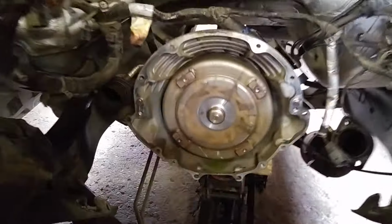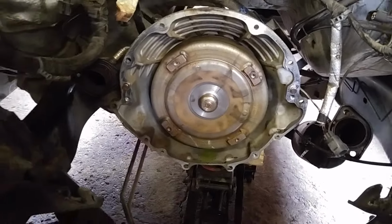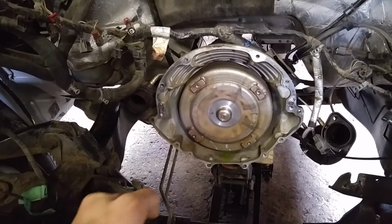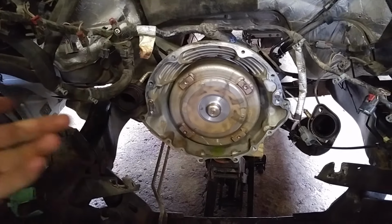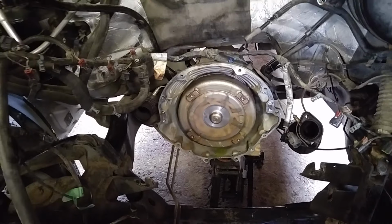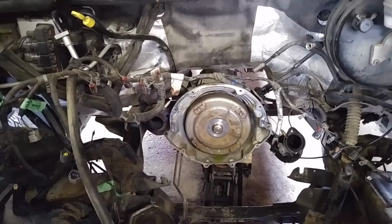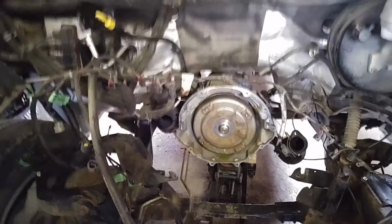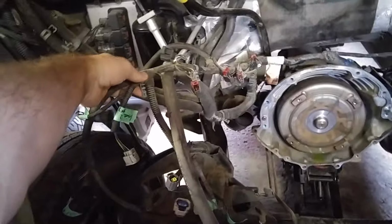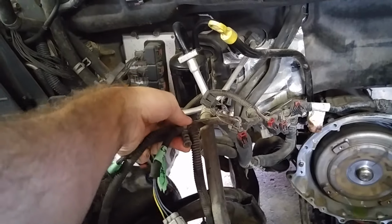You can see the bell housing has just 4 bolts on it to the flex plate. So just take off your lower cradle there, spin it over with the crank, and pull out all 4 bolts. It's not hard. Get your upper 4 bell housing bolts. Remember to label them, put them away. The starter was just 2 bolts, easily accessed, and a few connectors. Awesome. My F-150 was way harder. Get all your heater core stuff off. Everything on the Dodge is held on by these little nubs which go onto the top of the studs.